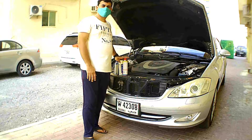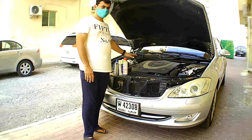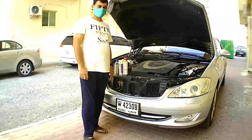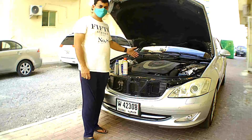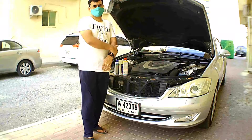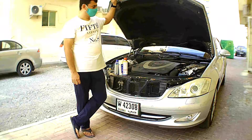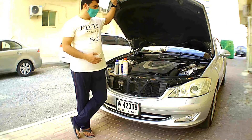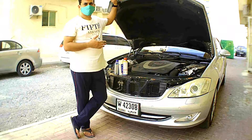In some setups you will not find a mass air flow sensor — normally there you will find MAP sensors instead. Your instrument setup will be different for different cars depending on the make and model, but the basic engineering and basic science will be the same. Now the question comes: why do we need this maintenance? Basically all your fuel trim depends on mass air flow sensor input, oxygen sensor inputs, and the throttle body condition.